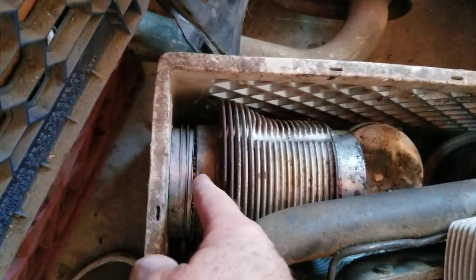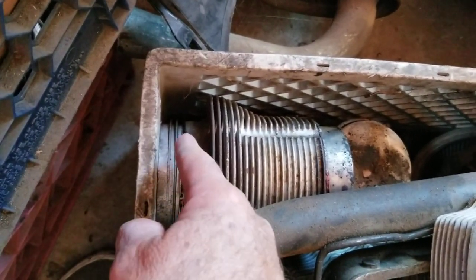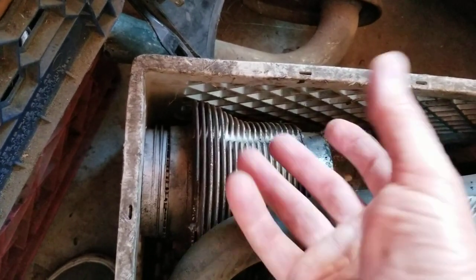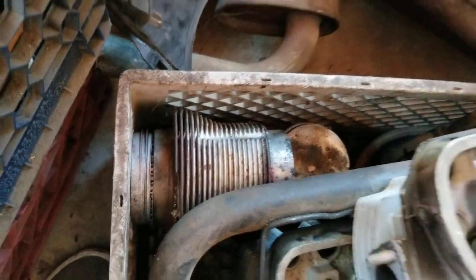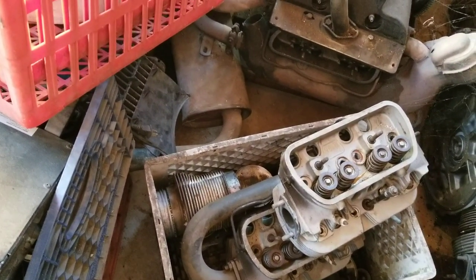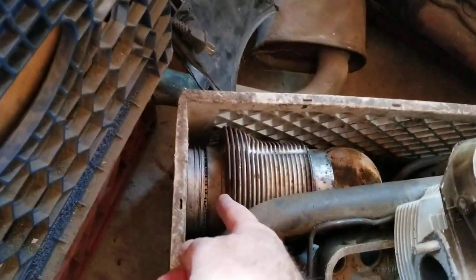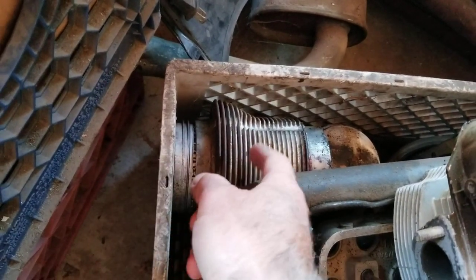And what you do is you open up your heads for the 92 to the same size as the 94, and it's a thicker wall than even the 94 is. Then you have this really thin wafer part that goes in. Now, you do lose some strength over here because there's always a little bit of movement that you can't see in your piston and cylinder, expanding and contracting. So you can run a 92 thick wall and still have a pretty bulletproof engine, because where the cylinder fires is mostly in the head. Your combustion temperature is mostly in your head, not as much in your cylinder.